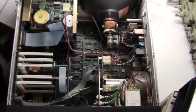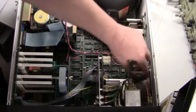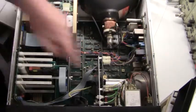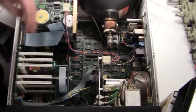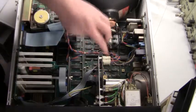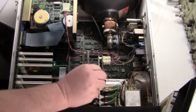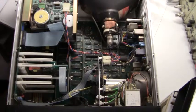These are a lot earlier. Apart from the CRT and the floppy disks we have the power supply over here. There's a massive input filter and a toroid transformer encapsulated in the metal enclosure. Over here we have a PCB standing up with all the rectifier diodes and the big power transistors mounted to it — and that's the entire power supply. You can see the quality is really strong; this is 2mm aluminium and everything branches out from there.